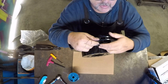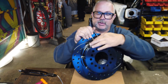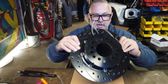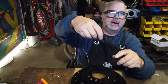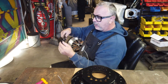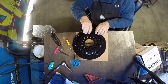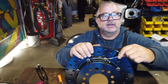You can see it's at an angle like this. I'm going to go to this bolt right here — I'm going to pull this one around underneath this one. The bottom one goes underneath, and then I'm going to twist them. You want to ideally twist in the same direction that your pliers are going to pull. Safety wire pliers have a locking mechanism, and you pull the handle back and it spins the pliers on an acme thread. These pliers spin basically clockwise, so you want to set it up going in the same direction. Pull it tight, get your loop started.